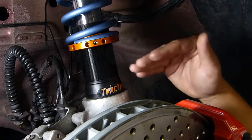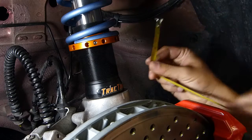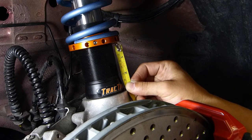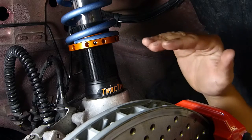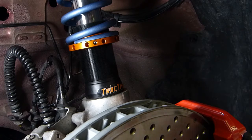The area that we're working on is clean. In this case, this is a newly installed shock, so we don't have to clean it. We're going to measure the distance of the exposed threads underneath the perch. We have 47mm here. Let's say we want to increase the distance to 50mm from 47, which means that we'll be raising the ride height by 3mm, or 1/8 of an inch.